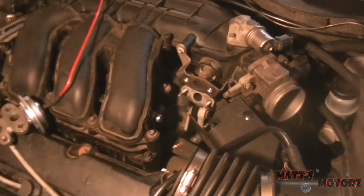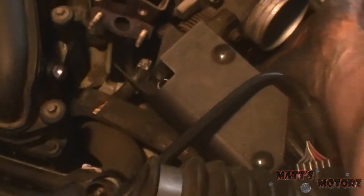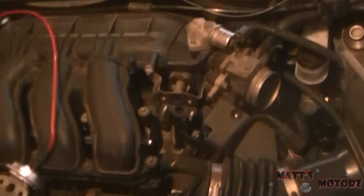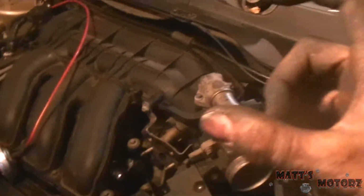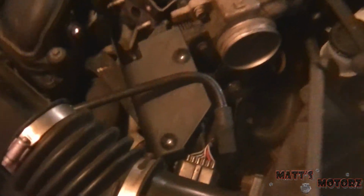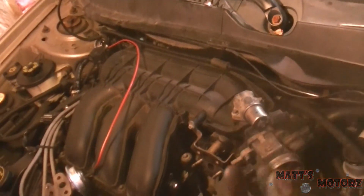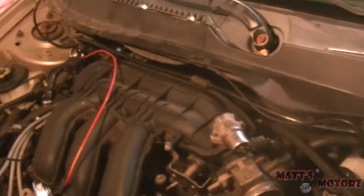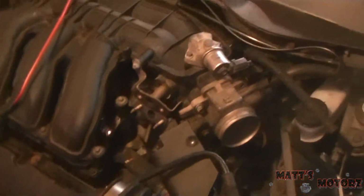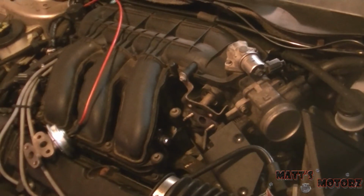Alright guys, it's a bit later and I was fishing around for this vacuum leak and I just couldn't find it, and then, hang my light up here, all of a sudden I realized there was a hose I forgot to connect on the bottom of this guy. So I said, oh great, perfect, connected the hose, and it got way better, but it was still running funny. So I start reaching my hand under there and feel another hose. Remember that big hose with the big clamp on it that goes right under here on the intake? That is all kind of rotted away, and there's a hole that developed on the side of it, and it's this weird part where it goes from like an inch diameter to 3/4 of an inch. So I am not quite sure how I can fix it right now. I might have to go to the dealer and get the actual part. So that's kind of what's going on. This is really annoying. I wanted this to be done, but I guess these kind of things just happen.